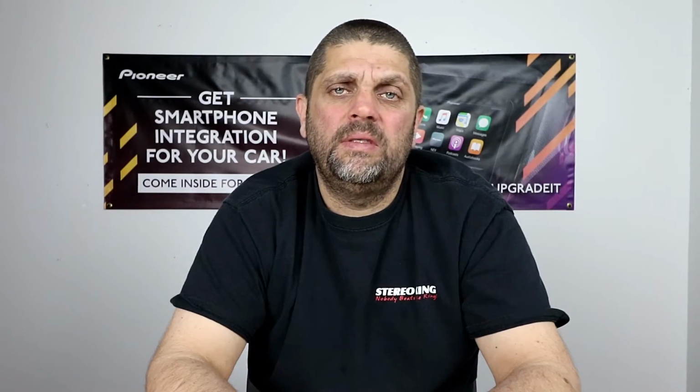My recommendation is you could buy whatever. You could buy a Kenwood Excelon 302, but get a processor. If you're doing a processor, then that takes care of all the ability to do the active system for you, and you don't have to worry about what amp to get as far as if it's got built-in crossovers designed specifically for active. Where would I put it? Hard to say. If you're doing a processor and you're going to do a 4-channel, you could just do a Kicker Key, to be honest. It's plenty of power to run it. It's 45 by 4 RMS. Yeah, and just feed it from a processor straight into that.